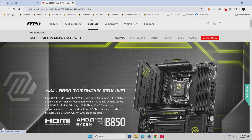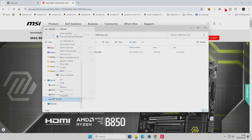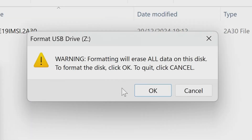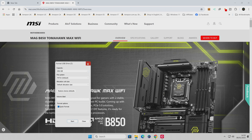We've got our USB stick so let's go ahead and plug that into our computer and get it formatted. As you can see, there is already a BIOS file on there, so we want to format the drive in its entirety. Go to the drive, choose Format, and make sure it is set to FAT32 — which is the default for this drive. Set the allocation size to default, remove anything in the volume label, and use the quick format option. Click Start — this will format the drive entirely, so transfer any data you need first. You'll get a warning saying this will erase all data; click OK, and you should get a message saying the format is complete.